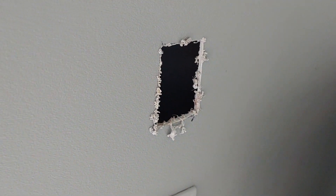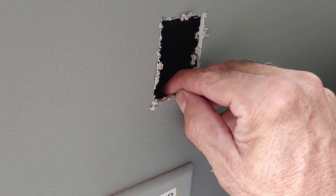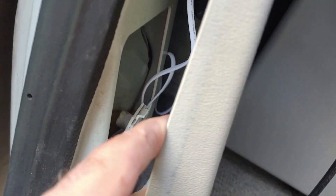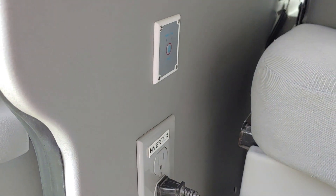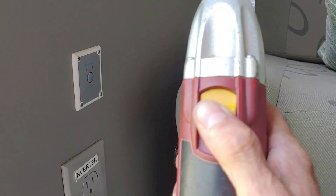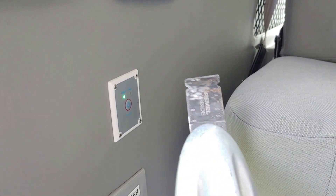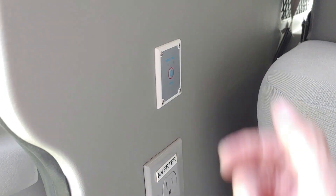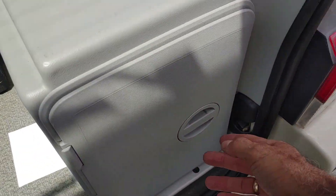I have the spot marked on the wall where I'm going to mount my remote switch. Because I now have power thanks to my inverter, I'm going to plug in my multi-tool and use that to cut the hole in the panel. That was pretty awesome — we got the hole cut out. We'll clean this up, mount the bracket, and run the wire through. We pulled the panel out, ran the wire up behind it and out the hole, connected it and screwed it in. Now if I try to power my tool up I get nothing, but if I hit the switch — I get power.